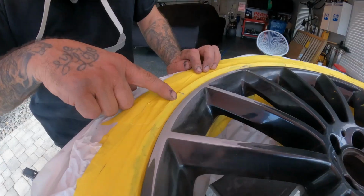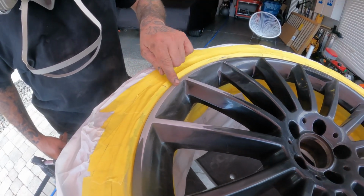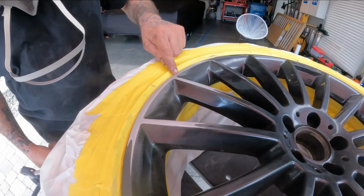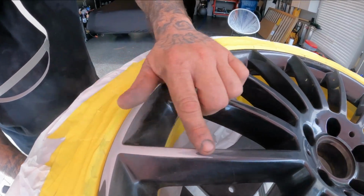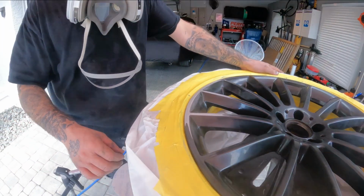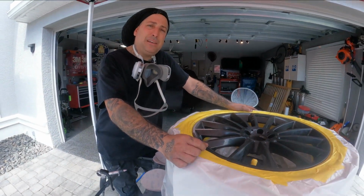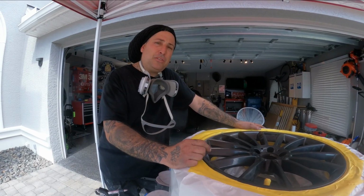All right, so we've removed all the paint and now we're into the aluminum on the wheels. You want to make sure you get all the scratches out with the coarsest grit. That way you refine it and you just now knock down the metal and get this fine, because we're not going to be priming this. We're going to be moving right into our 2-part can epoxy primer, wet on wet, and then we're going to get right into the base coat and the clear coat.